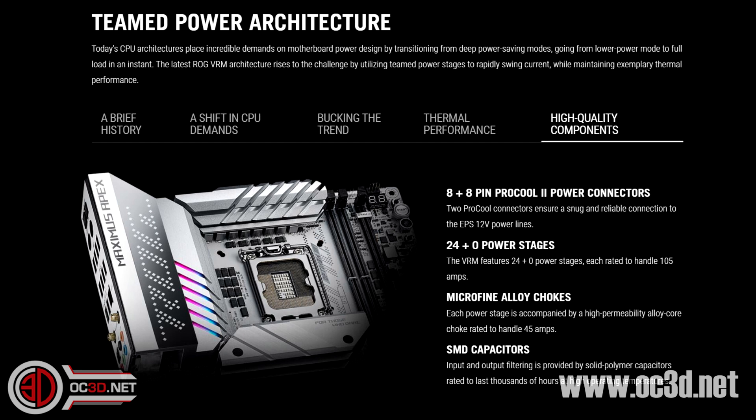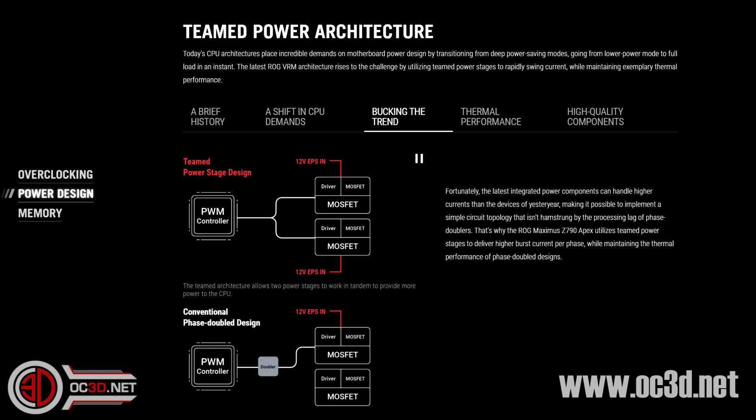When we're talking about the VRMs, they are teamed. One of the things I did want to draw attention to is that with teaming compared to a doubler — with a doubler, you only ever get one of the MOSFETs being driven at once, and you have the 12V EPS in at the top, so your CPU power coming in is either one or the other, never both at the same time. That's why teamed is better — you can see there are actually two powers in, two being driven at the same time, which manages to spread the load and drop the temperatures. When they first started doing this a lot of people were against it, but I've never personally seen an issue. The temperature difference between the VRMs on Asus boards and the competition is rather nuts, if I'm completely honest.